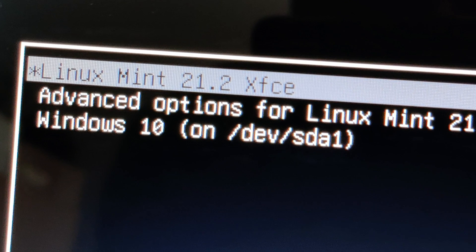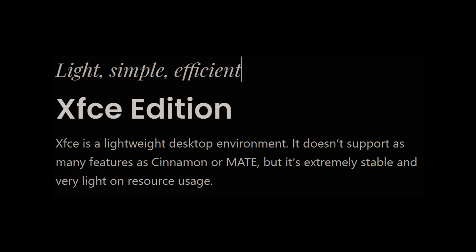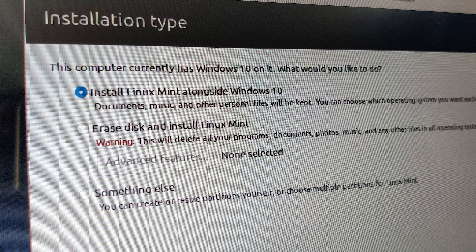What I really wanted was to dual boot Windows and Linux, so I went looking for a Linux distribution. There are so many to choose from. I avoided things like CentOS and Fedora because of the way Red Hat is treating the open source community at the moment. I went with Linux Mint, the lightweight version. Download it onto a USB drive — full instructions are on the Linux Mint website. When I booted it up it detected Windows 10 already there and offered to use the free space I'd left, setting up a side-by-side dual boot automatically. Once it booted up, the video driver is much better under Linux for this older hardware — I could watch 1080p with only about 50% CPU usage. Wi-Fi is working and the trackpad worked under Linux too, so I can use two fingers for scrolling. Linux really looks like the better proposition on this older laptop, but I still have the option to boot into Windows if needed.